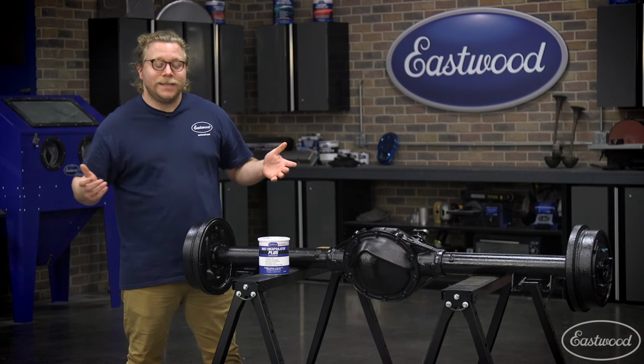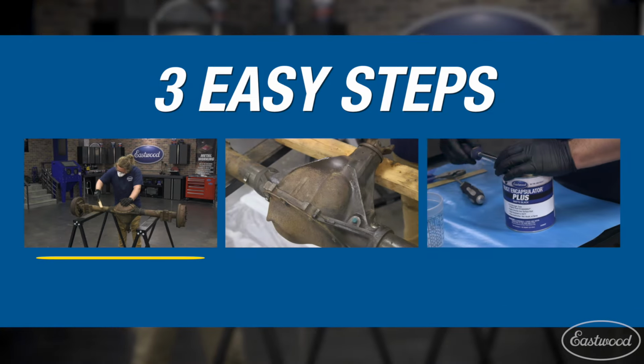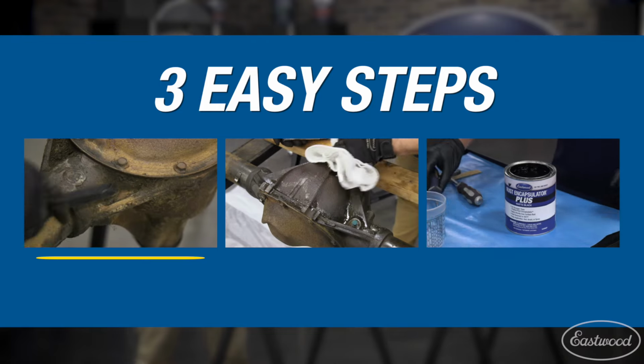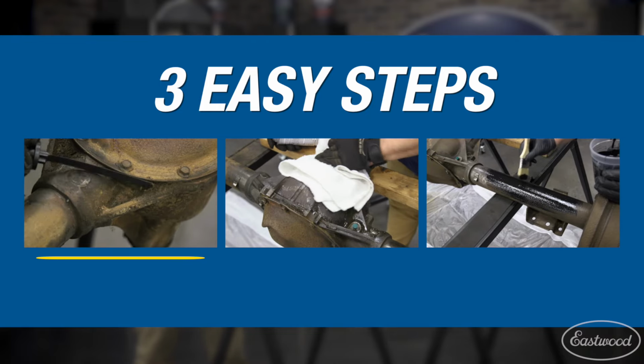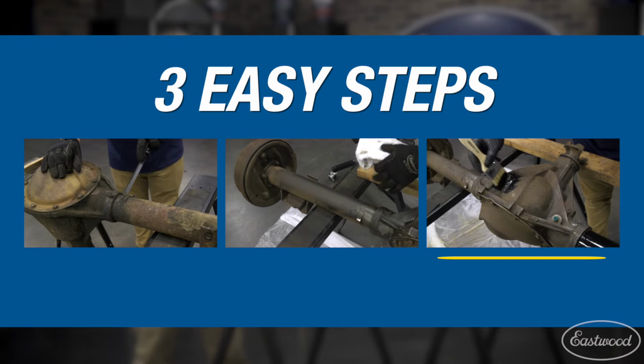Well guys, as you can see, it turned out pretty well. In all, it was a really simple process. We used a wire brush, knocked down the loose flake, took a non-marring scraper, kind of dug in there in all the nooks and crannies, got all the old dirt out of there, wiped it down thoroughly with prep, and it was ready to apply our Rust Encapsulator Plus.